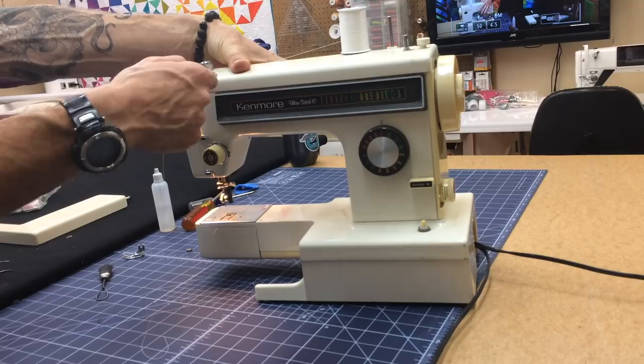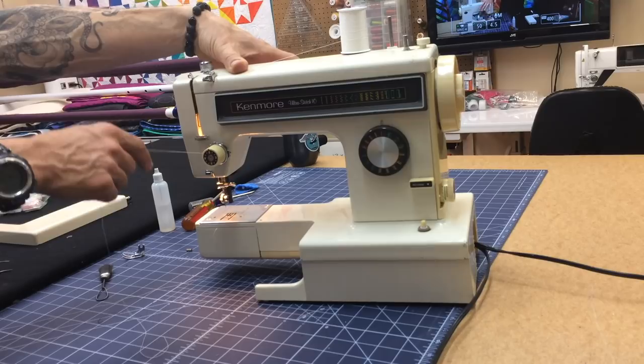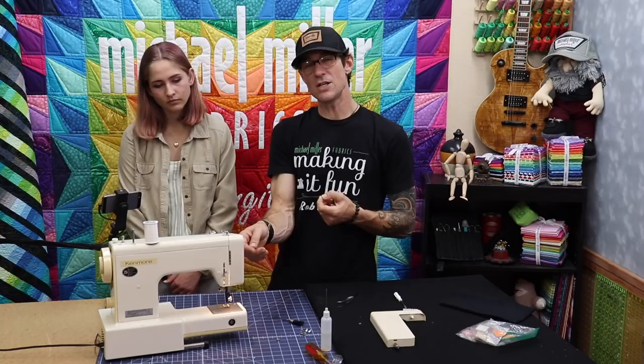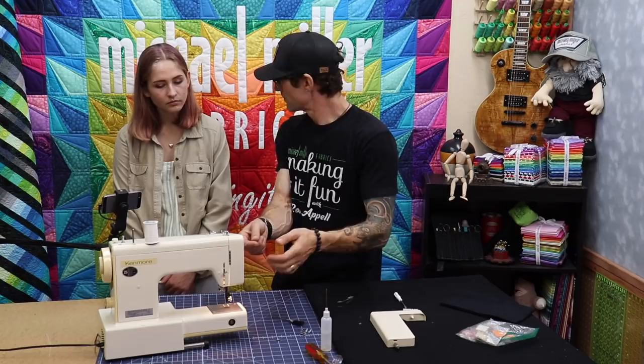Vianna, did you see how that came around? Yeah. Cameraman, did we see how that came around? And I'm pulling all the way through because there's a spring right on my pinky right now. That spring is now engaged with every stitch. If that spring is not engaged, that's another reason you're going to get erratic loops on the back side of your project. So when that came through, this guide keeps it in place.